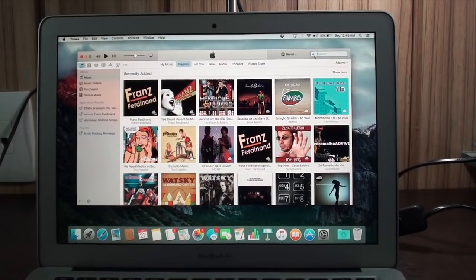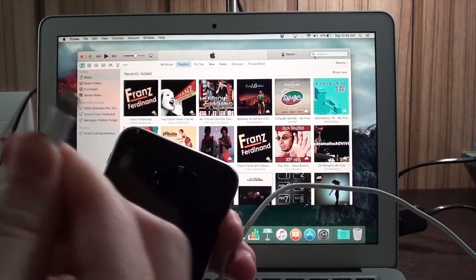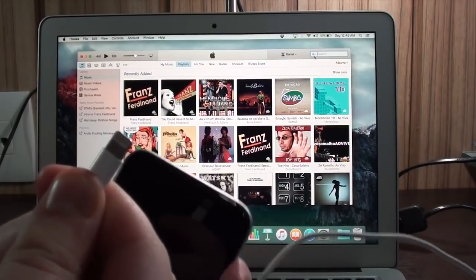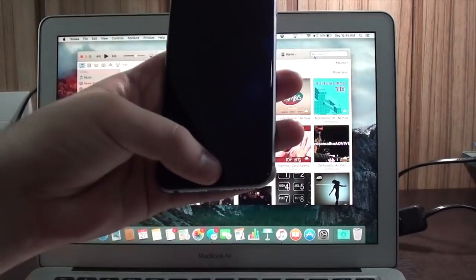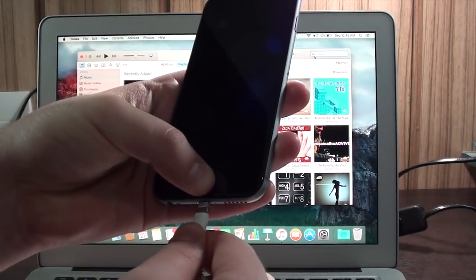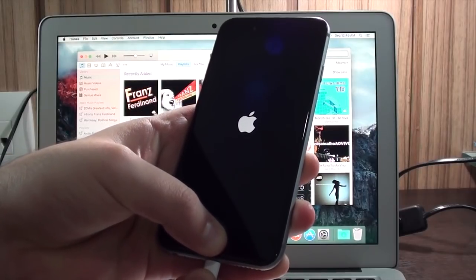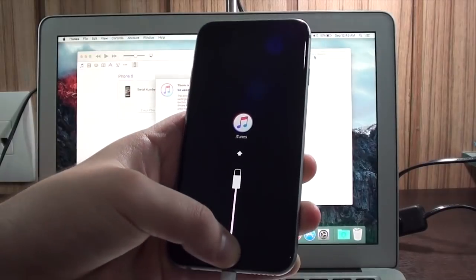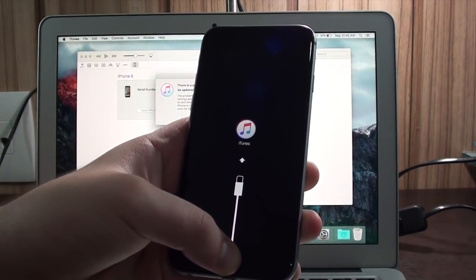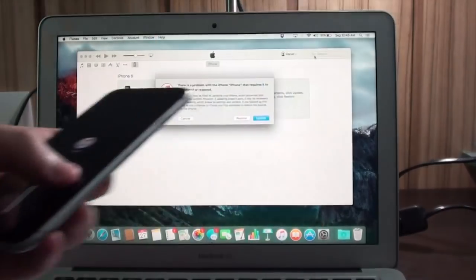After that, you need to have your iPhone cable plugged into the computer at the other end. Then hold the home button and plug in your iPhone. Keep holding — and then you're going to see the iTunes logo. Once you see it, you can release the home button and set your phone on the desk.